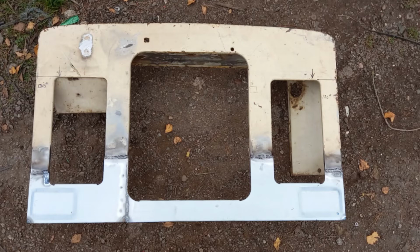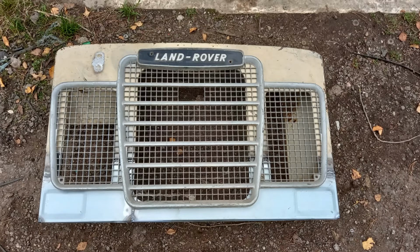With MIG welding in particular, you're never going to get it perfect. It's never going to be perfectly flat after you've ground it. So just make sure it concaves a little so you can then effectively repair the damage with just a wipe of filler. Now this panel's actually getting galvanized and you'd be amazed how much that smooths out grinding marks. After this thing was galved, you could not see them, but you'll see that in a moment.